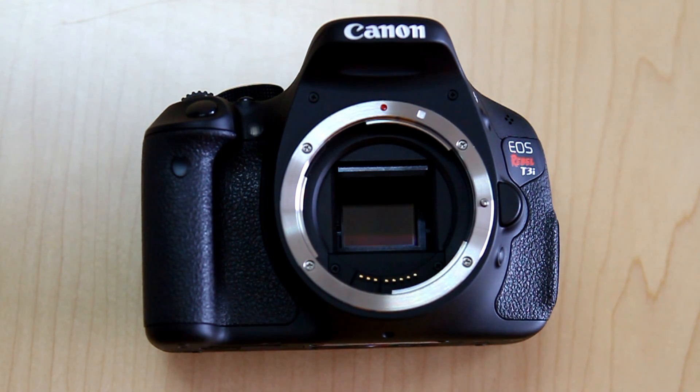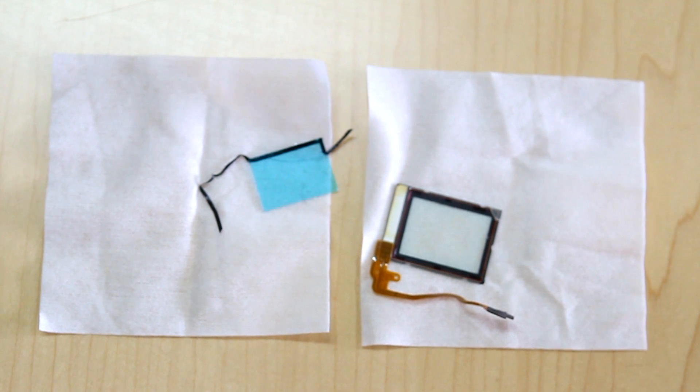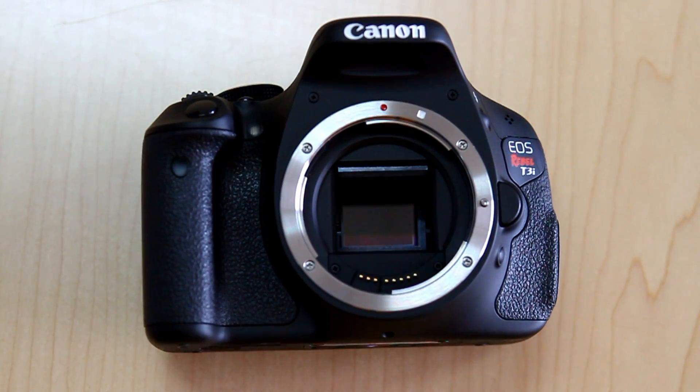The camera you see before you is open with the shutter and the mirror flipped up so that hopefully you can see into it. The damage done to the camera when they change the filter is minimal — in fact, none. They break probably the filter as they take it out but that's about it. Cameras by default filter out anything ultraviolet and anything infrared. The normal spectral range that we can see is above 400 nanometres. For UV we're heading below that — CMOS sensors are likely only able to interpret above 350 nanometres, and that's really what I'm aiming to do.